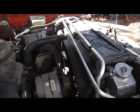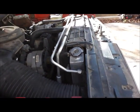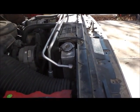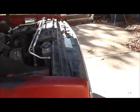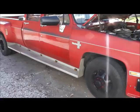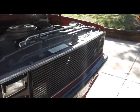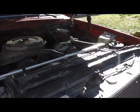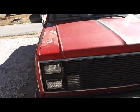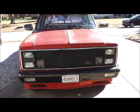When I'm running down the road without a load, this thing doesn't even see 200 degrees. With the camper on a hot day, I can run between 210 and roughly 230, and 230 is a little extreme for me, but that's when I'm really pushing the truck, trying to get 60-65 mile an hour out of it at like 3,500 RPM. I do not recommend that. The truck prefers about 55 mile an hour, about anywhere between 3,000 and 3,200.